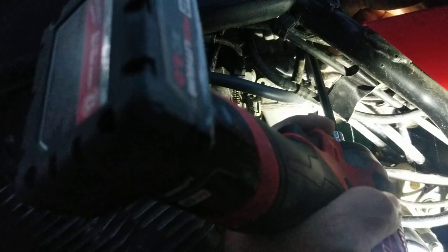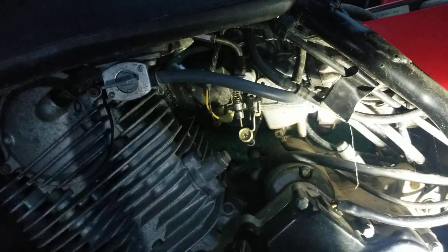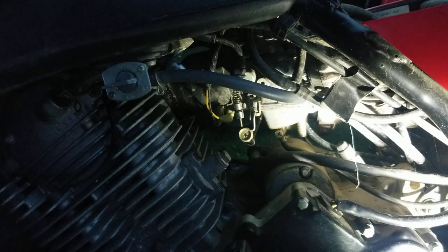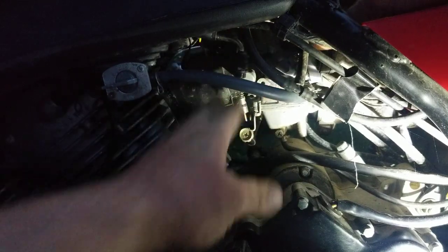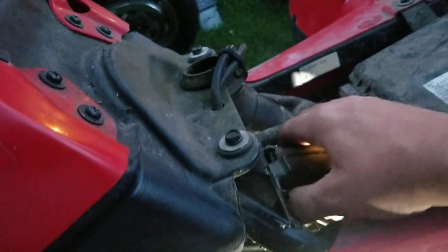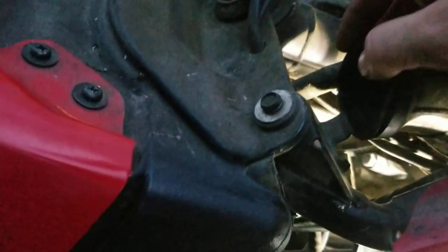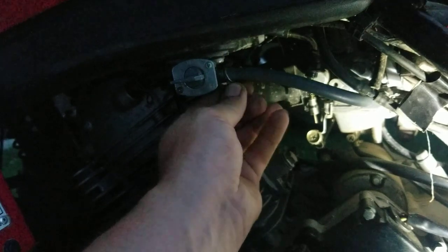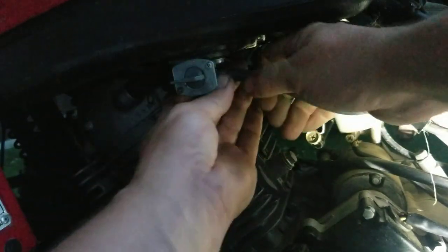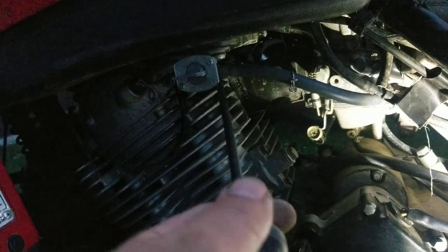Got that part squared away. The cable goes on the other side — pull the front bellow off. I just pulled this bellow off right here, the air intake. That's up out of our way, and now we can see the carburetor up underneath there. We're going to pull that out in just a second. The fuel line is right here — sorry about that guys, just knocked it down. Get that clamp off there. You can tell nothing has really been off this machine before — it's the first time this has ever been apart.